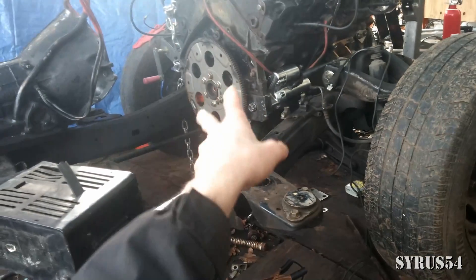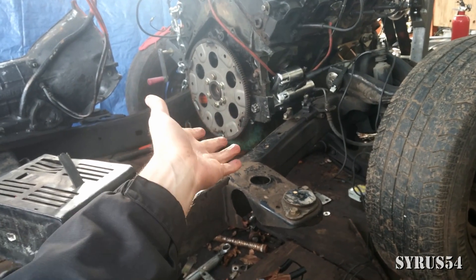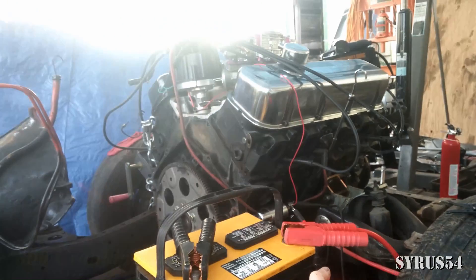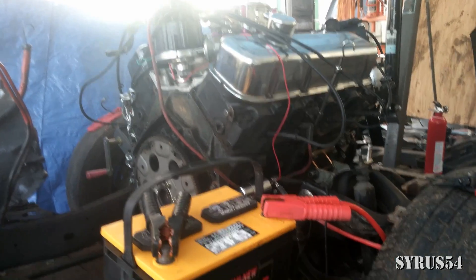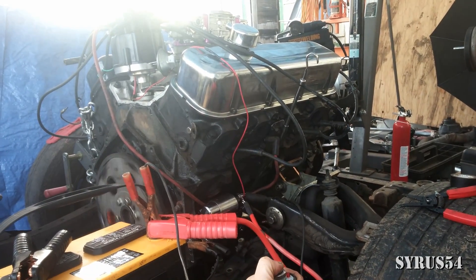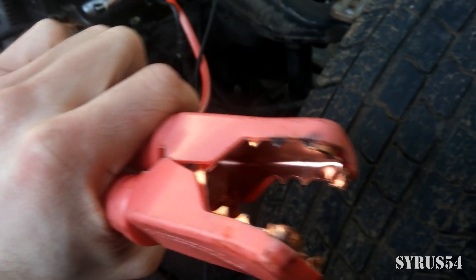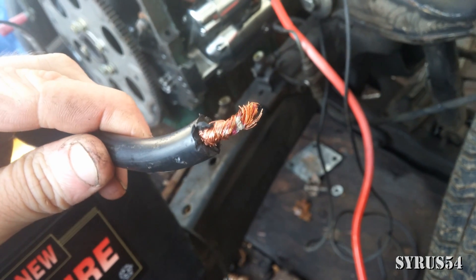My main issue here is that I just recently put in some new piston rings and they haven't been broken in yet, so it's really hard for the starter — even though it's a high-torque mini starter — to turn the engine over. I have an 800 cranking amp new battery. These tiny little cables just aren't rated for that much power — you can see scoring on them and the negative started to get warm and almost started to weld.